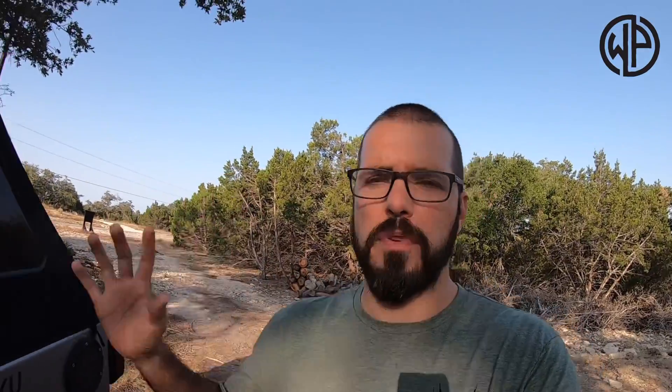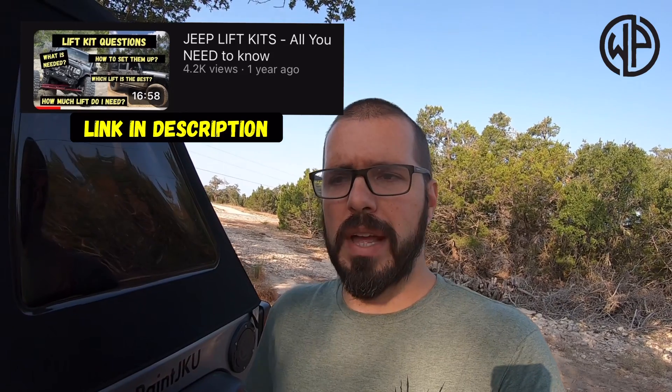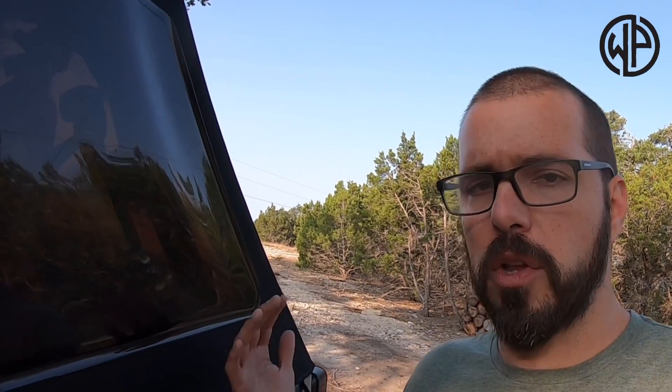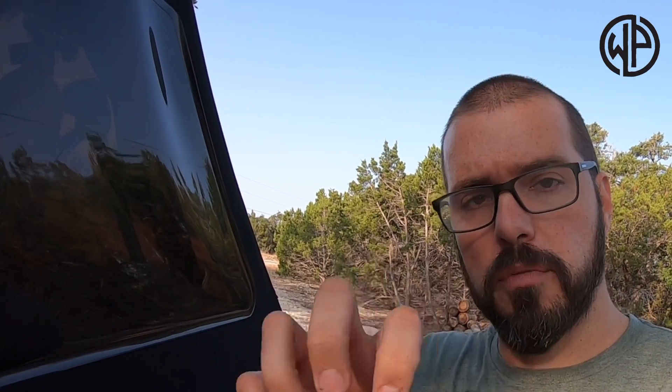When it comes to suspension, there are a lot of different options, and I made a video that talks all about lift kits. Warpaint here has a pretty custom suspension on one-ton axles, so it's a little bit different, and that allows me the safety and reliability when running a 40-inch or larger tire and doing the harder things off-road. Research it — don't fall for stuff that just happens to be painted the color you like or is at the price point you're comfortable with, because you might be able to buy good springs and a good shock that matches that spring and all the other components for a lot cheaper.